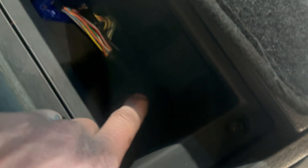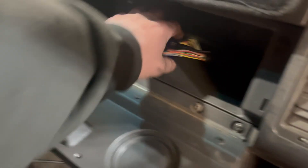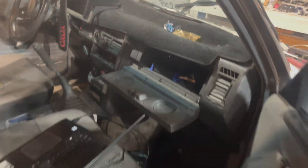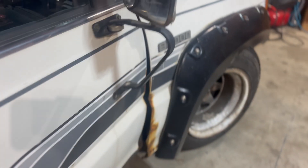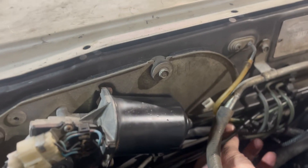Into the glove box is where I like to put mine. There is a hole drilled in the back corner of my glove box. You take the glove box out, take out these two screws and these screws, glove box comes out. And you just put the harness through there. Pretty simple. The harness comes out and then everything splits off and divides right here.